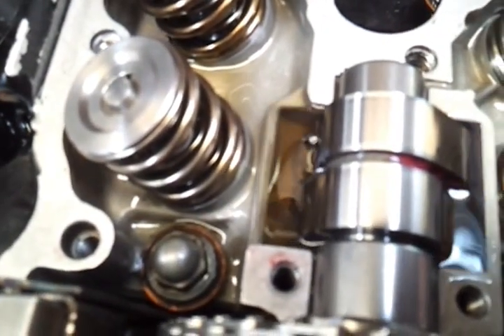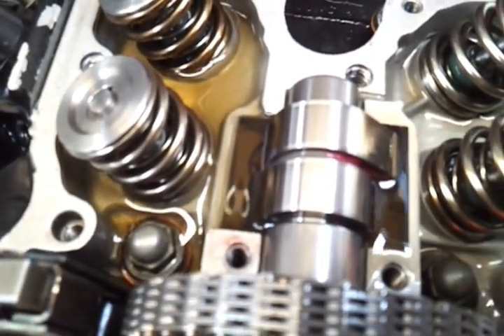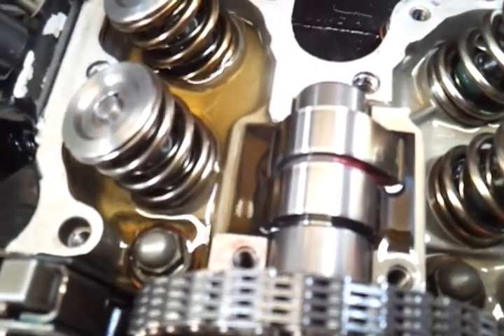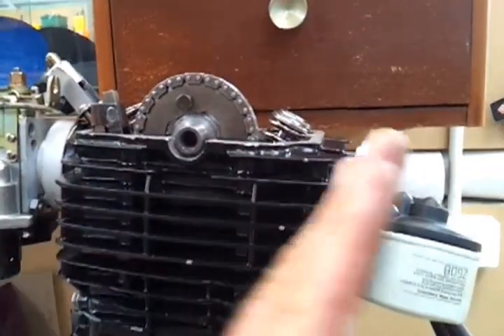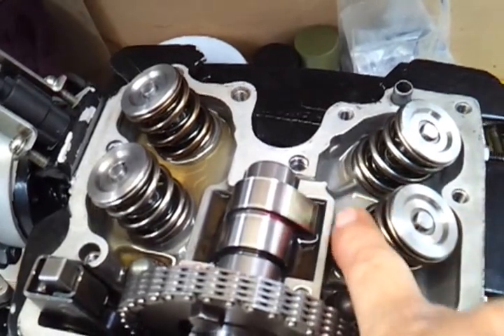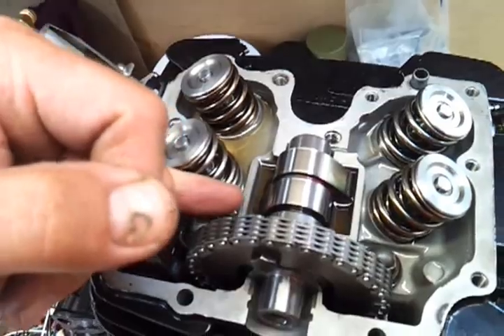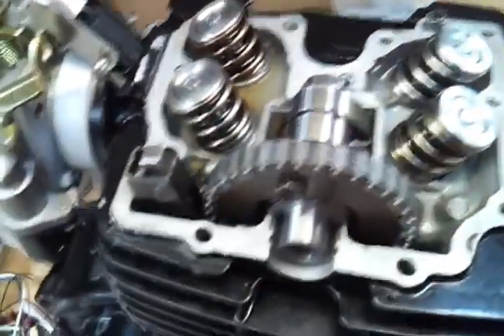So there comes the oil. That's the amount of oil that sits in the oil bath underneath the camshaft, just while the engine's idling at about 1,200 RPM. I've got the engine sitting up quite level at the moment — normally it would be sitting that way. So there's not much oil tipping forward into the exhaust, around the exhaust valves to cool them. That would normally tip out there, but there's a shallow side on the inlets, just because of the way I've got the engine tipped up at the moment.